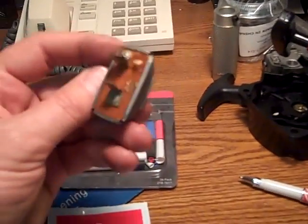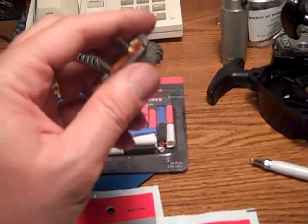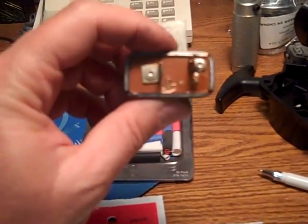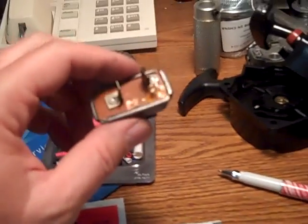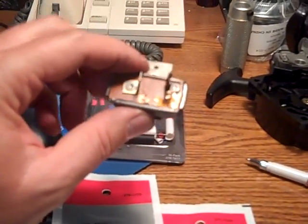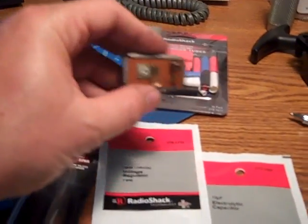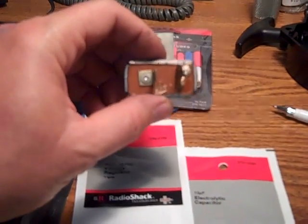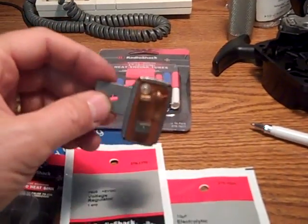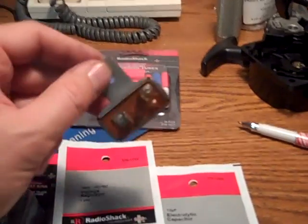Here's the old instrument cluster voltage regulator. From my understanding it's just bi-metallic — it heats up, makes contact, then it causes it to open, then it cools and closes, and it just goes back and forth. It's taking 12 volts and modulating it, tricking the cluster into thinking it's an average of 6 volts, because the old instrument gauges back in the 60s were 6-volt gauges left around from when cars were 6-volt systems. Now they're 12-volt systems, and Ford had millions of the old gauges laying around, so they continued to use them and had to step down the voltage from 12 to 6. When this regulator goes bad — which it frequently does — your gauges start freaking out: fuel, temp, ammeter, whatever you've got.